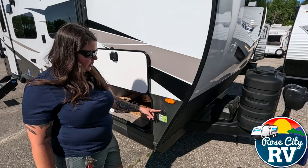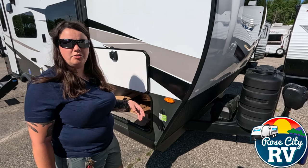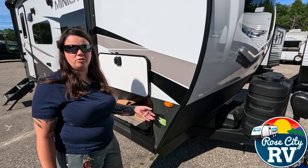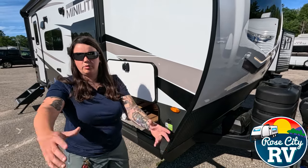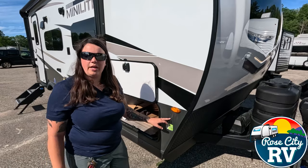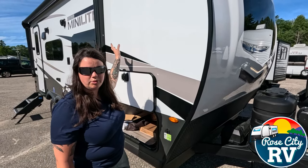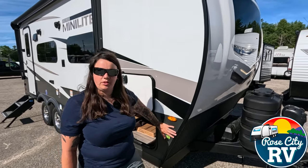Moving on to our solar on the side option — this is for portable solar. If you want to add additional solar or you're parked under a big tree and want extra solar, you can get what they call suitcase solars or backpack solars that you can move around. Just make sure that you have a voltage regulator because this does not go through the 30 amp solar controller that's inside, so you need one that's built into the panel if you're going to use this function.